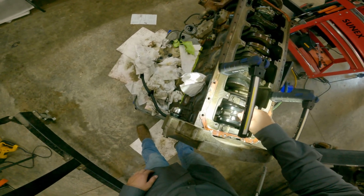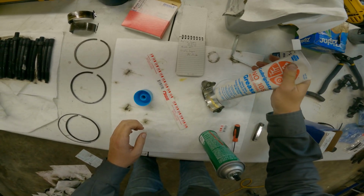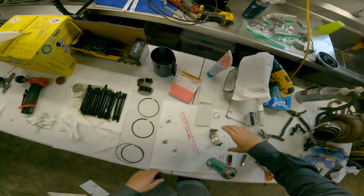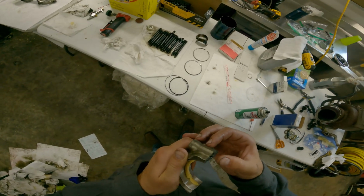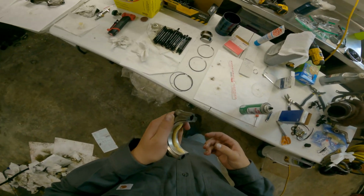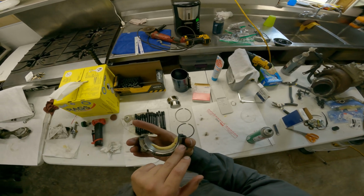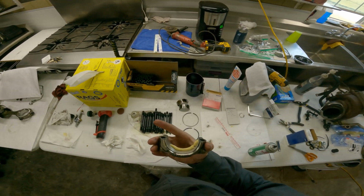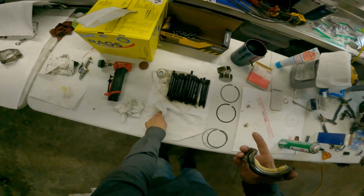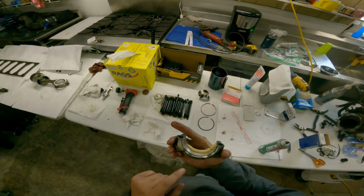Perfect. All right, a little bit of lube here. I want to make sure that this tang is level on this side because we got level on the tang side on the other one. The cap is not a perfect break. This side is a little low, so the bearing is going to be a little high here because on the rod the bearing was sitting inset whenever it had this side over here flush. So it's something to pay attention to, something to keep in mind when you're doing these broken cap style rods.